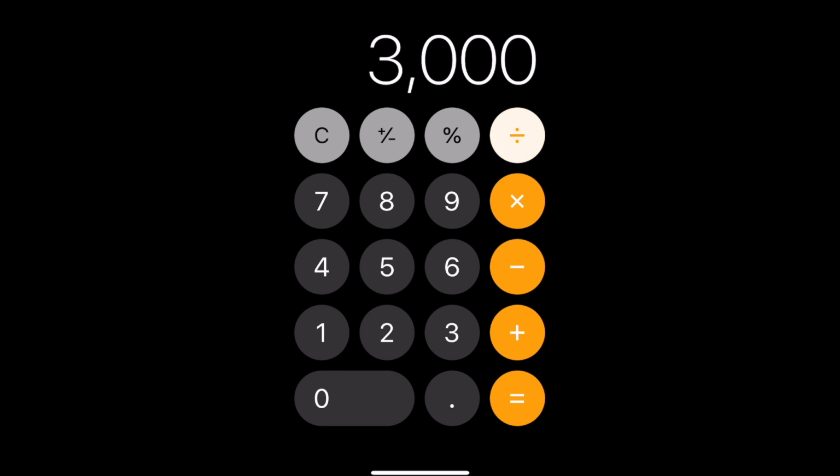So I got to have at least 2 batteries to be able to supply that kind of amperage. If you think about the maximum that our inverter can supply, it's a 3,000 watt inverter. 3,000 divided by 12 is 250. So if my inverter is maxed out at 3,000 watts, it's pulling 250 amps from the battery. So when you're sizing things, an inverter is probably going to be the biggest draw.